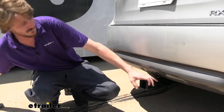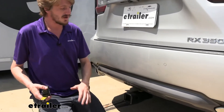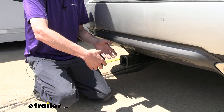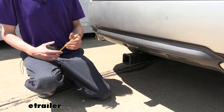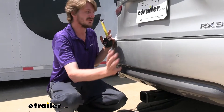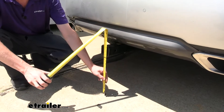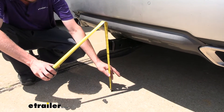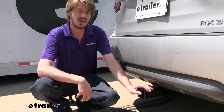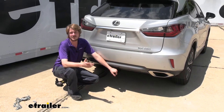It is a 2-inch by 2-inch receiver. We talked about how great that's going to be for all your accessories, but we're going to give you some additional measurements. From the center of the hitch pin hole to the edge of the rear bumper, it's right at about 2 inches — that's important when determining if your accessories can be placed inside the receiver without contacting the bumper, and if they can be placed in the upright storage position without contacting the bumper. From the ground to the top inside of the receiver tube, it's right at about 15 and 1/2 inches, and this is important when determining if you need a drop, a rise, or a shank on your accessories. Now that we've gone over some of the features, why don't you follow along with us and we'll show you how to get it installed.